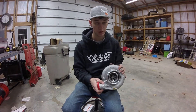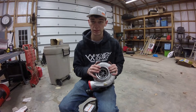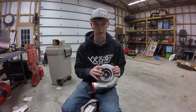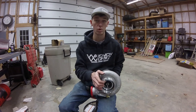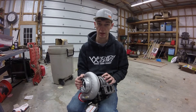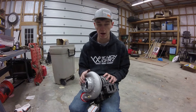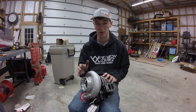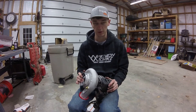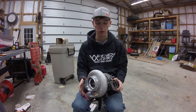I just wanted to show you what was going to be going on Jacob's truck and what modifications were done so you guys could do something similar. I know a guy running a 62x67 16cm HX35 on stock fuel with the lift pump, governor spring, and all the small upgrades — it spools very well, and this should spool even faster. This is more of a towing turbo. If he hooks this thing to a gooseneck, it should do very well. EGT should definitely be in check, it flows all you would need, and it should just straight up rip with a lot of low end torque. His transmission might not like it, but he's going to want to do something with the trans with all the modifications he's doing.